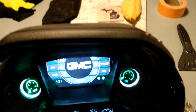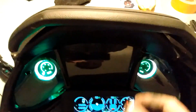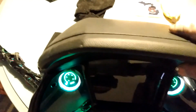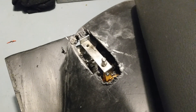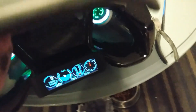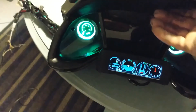The best route I found is to use a small 12-volt solenoid. It actually physically presses the power button for me. You can see it controls the screen on and off just by pressing the button. I built a bracket attached to the actual cluster frame and attached the solenoid to that, making sure it's positioned right over the power button. That way you can control the power button without ever touching the tablet. Total setup cost: under about $200.